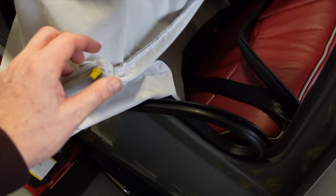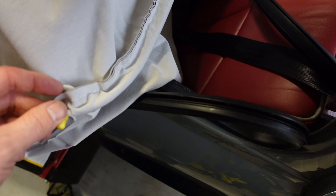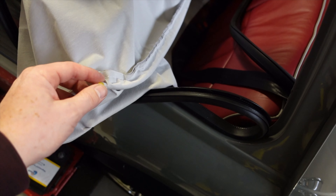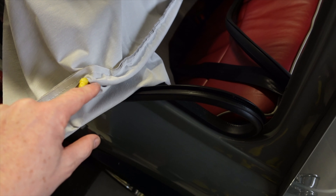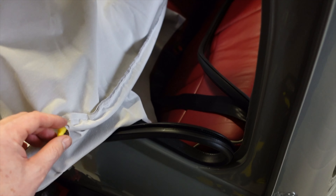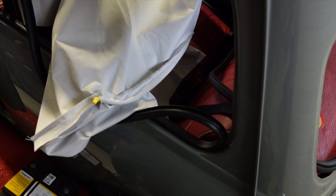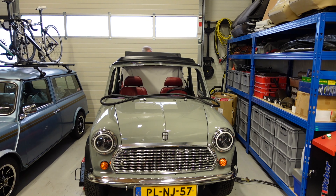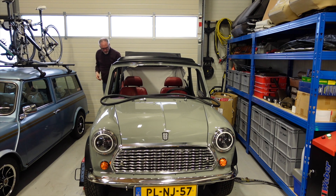You can see this is where I'm talking about - this slot doesn't go far enough back to stretch the material, and it tends to gather on the end of the rail. So I'm going to just cut this a little further up to allow the material to slide a little bit longer, and I'll do that on both sides. Hopefully that takes out the gathering in the corner.